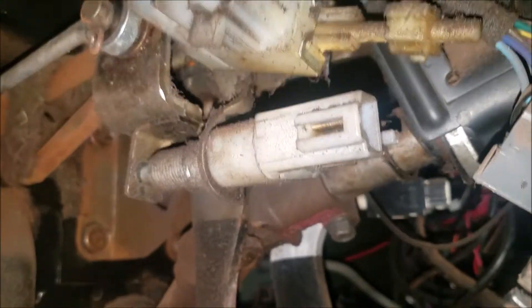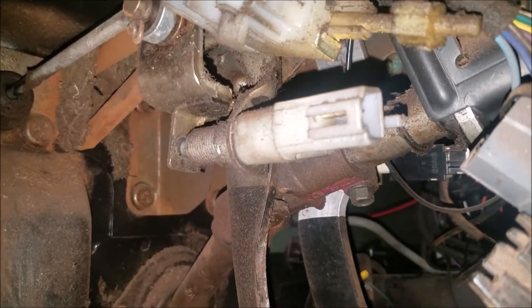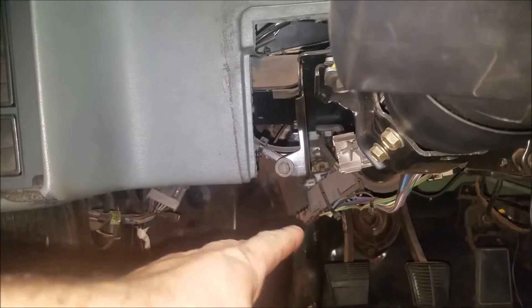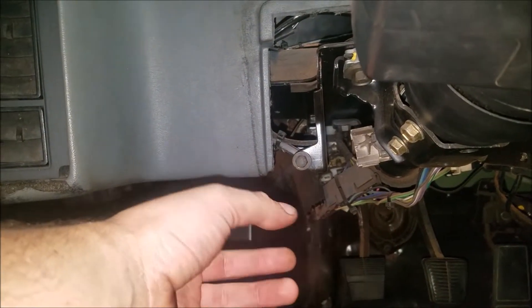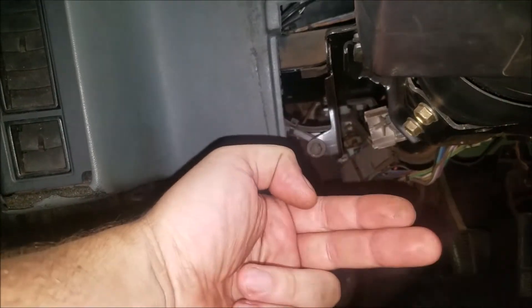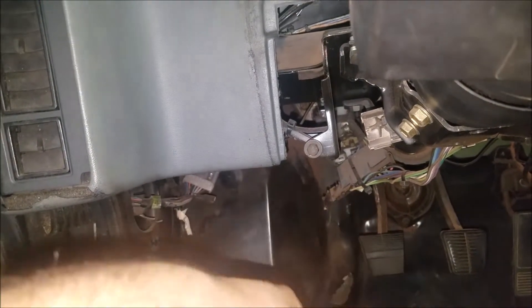I took my giant loom and dug out the spare ADC — that's what I'm gonna be using. Basically you're gonna run a spare ADC down to a switch on the clutch. When you step on it, it lets go. Hopefully it's like when you step on it it releases the button and makes contact, completing the circuit — letting Micro Squirt know that it can do its two-step, launch control, or no-lift shift.